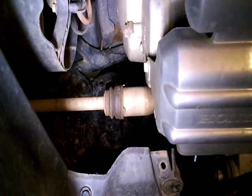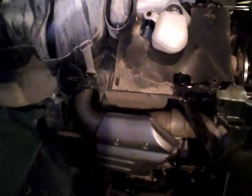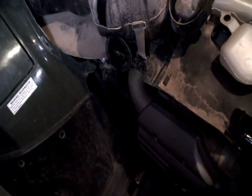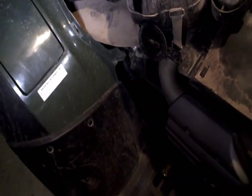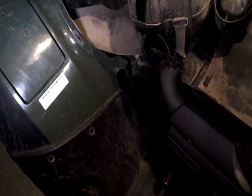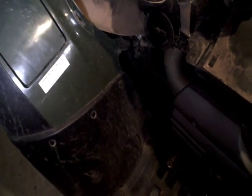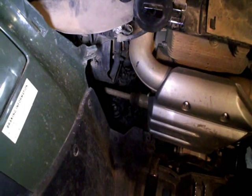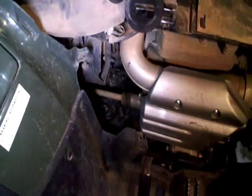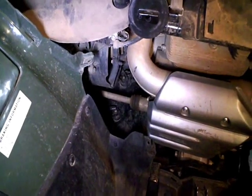Anyway, essentially there's a screw shaft there in the middle and a lock nut, and you'd undo the lock nut there, and then you'd turn the center screw there one turn clockwise. Then you'd slowly turn it counterclockwise until you feel resistance when the plunger hits the end of the clutch, and then you'd back it off about a quarter turn clockwise, and then lock that nut at 22 Newton meters. I actually had that adjustment plunger seize in that front cover. It got corroded in there, and I actually had to take the front cover off and press it out of that case, and went ahead and replaced it and greased it up good, so that's something that can bind up.